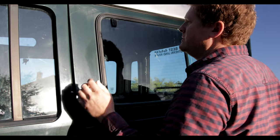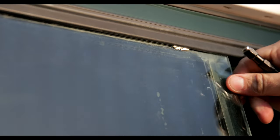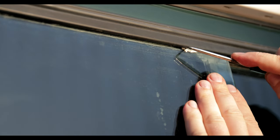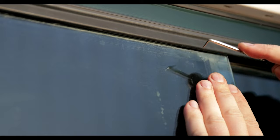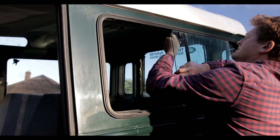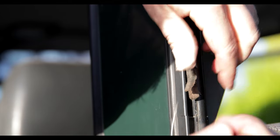These sliding side windows on the county station wagon version of the Defender are notorious for rattling with age. I've even had to wedge mine with a bit of paper to stop it from driving me mad. But again, it's an easy and cheap fix. Shout out to Britannica Restorations on YouTube, as this is where I learned how to replace them. Firstly, you need to remove the old felt, often in bits and pieces.